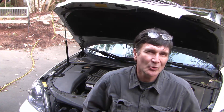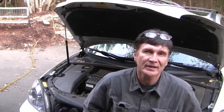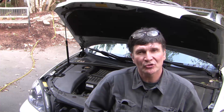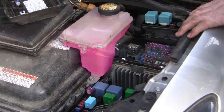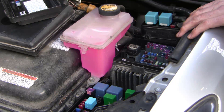The first thing to realize is how different these vehicles really are. There's no dedicated starter motor and instead they've got a huge and powerful electric motor driven by the main engine battery, not the accessory battery. And instead of an alternator, that same system is used to regenerate power to recharge both the accessory battery and the main engine battery. The accessory battery still does power the electronics and it's used for many of the electronic relays, including those responsible for lighting and safety.